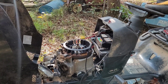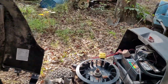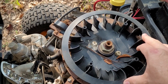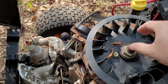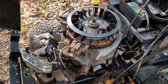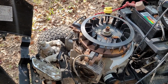So I drained the oil, or what might have been still in there, put some more oil in it. I let it cool off, and came outside with a breaker bar on this nut, to try to break the engine loose, and I was able to do that, get it to where it would spin, and it'll turn over just fine. So it would turn over, but it wouldn't start. And I did a compression check, and it had absolutely zero. It didn't even move the gauge. So I knew there was a problem.